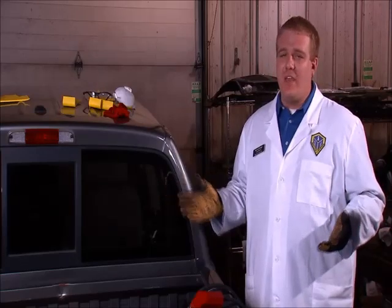Our first application of the glass blaster is removing bonded auto glass. Since we heat the window from the outside of the vehicle, in most cases we don't need to do any preparation, like removing the interior trim. However, in rare cases, there may be electronic equipment mounted to the glass near the edges of the window. We want to remove this ahead of time.